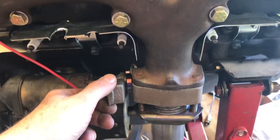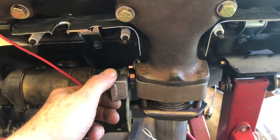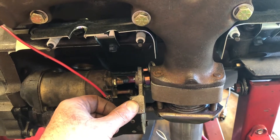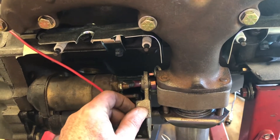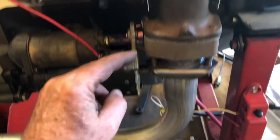Now of course you don't want hot exhaust the entire time, so once that has warmed up, the engine is warm and this will start to turn to a down direction, which means the flap inside here is now more vertical, allowing exhaust to correctly flow out the exhaust pipe.